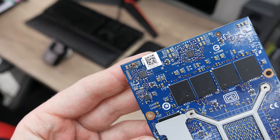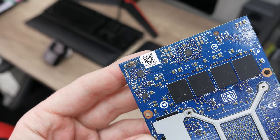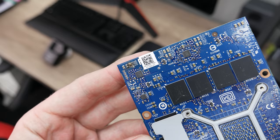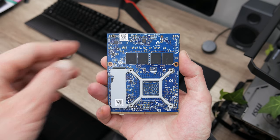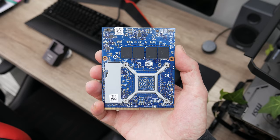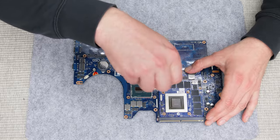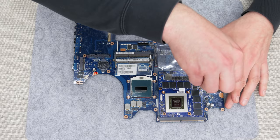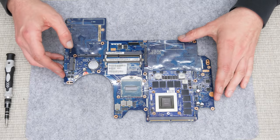Simply, we're going to do nothing here. Probably you'll ask, but why? So first, the GPU is working perfectly fine. The component that was in a short circuit has burned down and it's isolated by itself, so no short circuit anymore. The GPU is working perfectly fine and it will continue working with no problems. So basically, I won't open some problem because there's no problem.